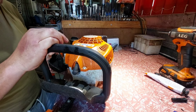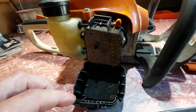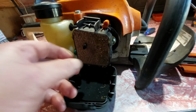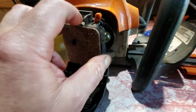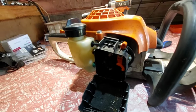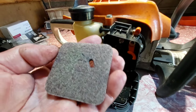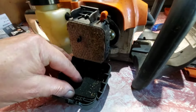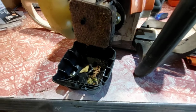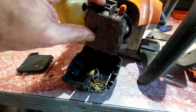First we'll check the air filter. So it's been used a fair bit, it looks like. You've got to think, it's not a heavy dusty thing to use. It's doing tree work, hedges, so if you get dust in here, you must have done some work with it. So, pull that out. Ooh, look at that, really fuelled up. I haven't started this thing. Says you might have some spit back. And that one here has got heaps of dust. Oh, heaps and heaps of dust. I'll blow that out before I try and start that.